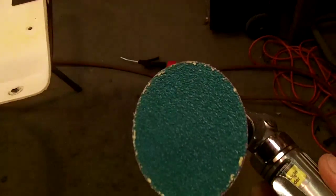So what you do is clean it really thoroughly. I take a 50-grit roll-off disc on a grinder and very slowly grind any high spots off. Because these holes were drilled, there was slag and stuff hanging on this side, so you take that 50-grit and knock it all down. Then I go over it with 80-grit on a DA, then 180-grit on a DA, clean it up, blow it off really well, and cut your patches.